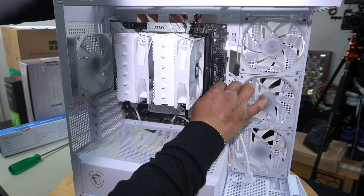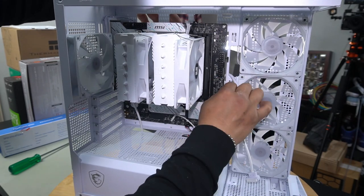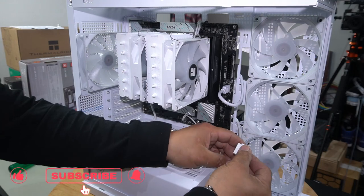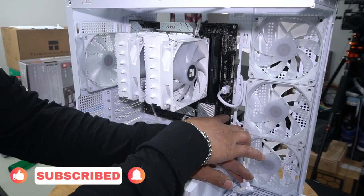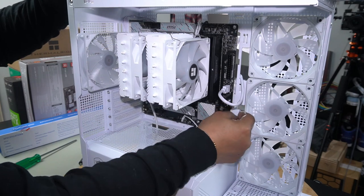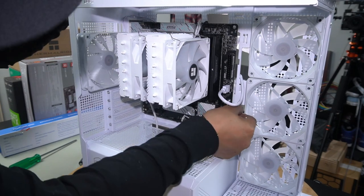Here's our Type-C right here. Bend that in and plug it straight in. Do not listen to anyone that tells you it goes in either way. It does not. It can only go in one way. For a USB 3, you've got a tab right here, and there's a tab just here. Go ahead and align that. Be very, very careful. These 19-pin USB 3.0 cables can easily bend the pins inside the port.